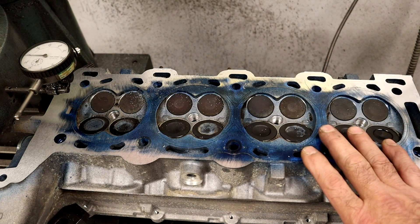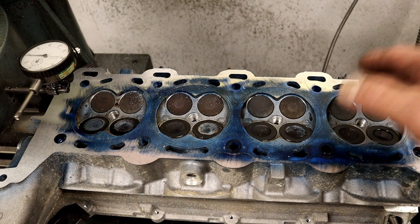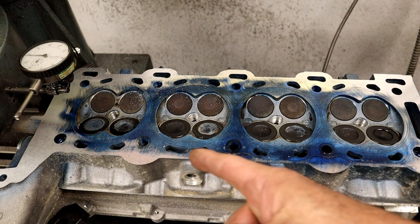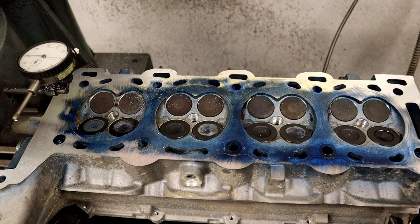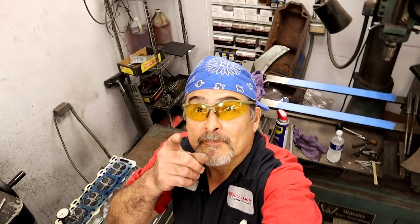All this diagnostics, the labor that went into putting this pair of heads on — dual overhead cams, brand new head gasket — fire it up, run it. In the first day it started leaking already. Look at that. Leave the Scotch-Brite alone, people. Leave it alone. Throw it away. Go to the back of your shop, the back door, toss it as far as you can. Have the youngest guy at the shop go pick it up and toss it even farther. It has no place in the shop.